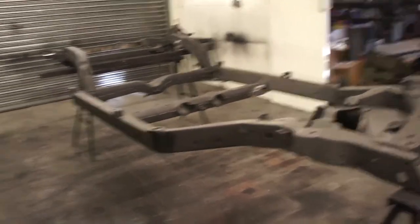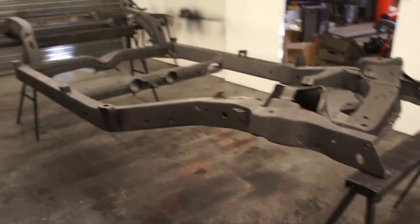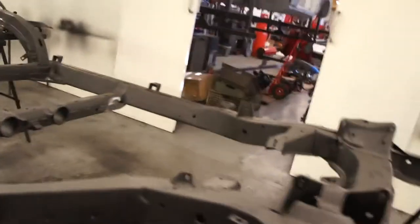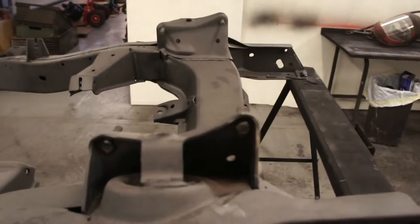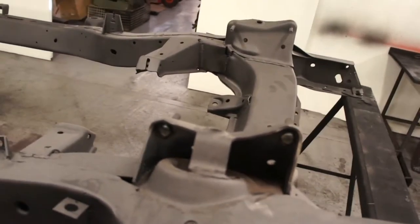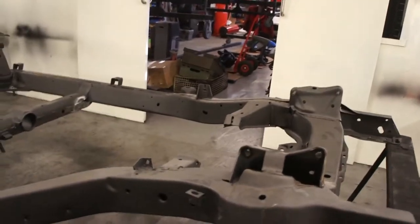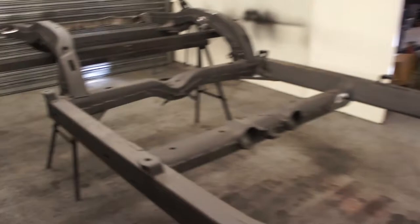Hi Francis, I've got your chassis back in the paint shop now. We've put a tack of weld just on the back of each A-arm stud because they've got a habit of turning when you start to do wheel alignment and whatnot, so we normally put a tack of weld on there just to hold it.